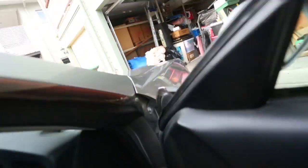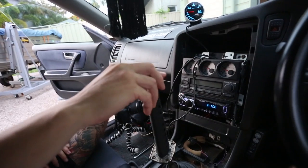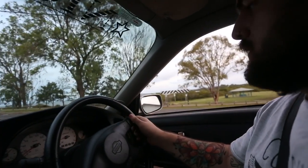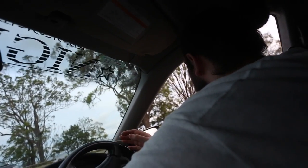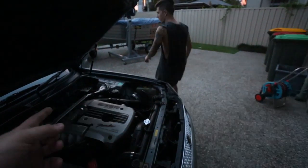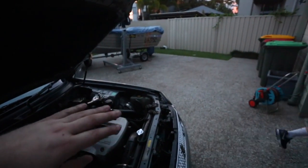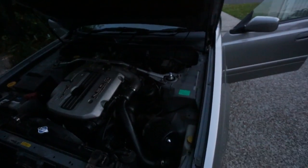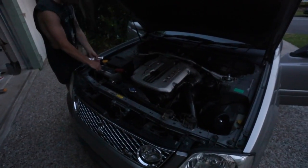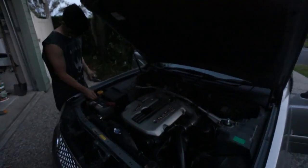After having a little bit of trouble trying to figure out how to set it, we think we've kind of set a PSI. We're just going to go for a little test drive. What the fuck was that — we just ran over something. There's some really weird boosting happening. It was going up steadily, but when it was set at 14 PSI it was coming up as only 9 PSI. We're going to try figure out if the vac lines are on wrong or what. If not, we'll probably leave it at 8 PSI because that's stock, tuck all the wiring away, and figure out what's going on.